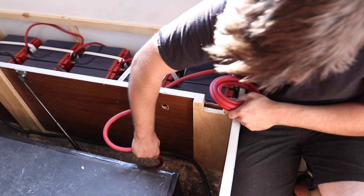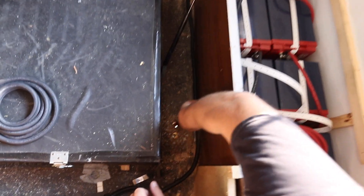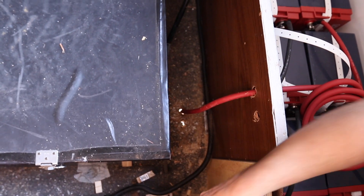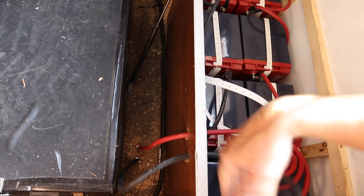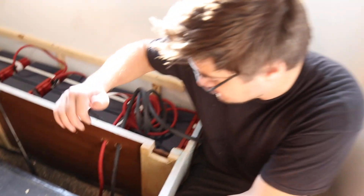Running the cable through the holes and down. The holes were made bigger to accommodate the lugs on the end of the cables so they can fit through. This is all theory until it's done — just a rough plan. Now we need to prep the battery bay to accept all the equipment, figure out cable length, cut the cables, crimp them, and put them in for real.